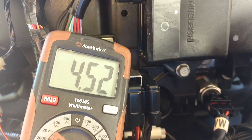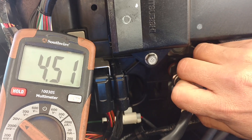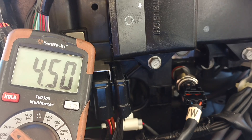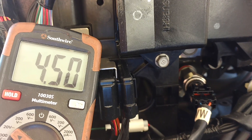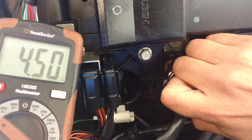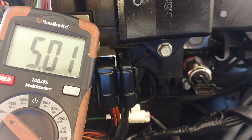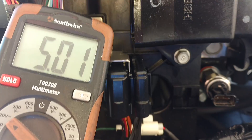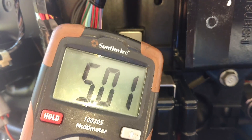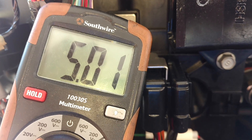So let's see what happens when we disconnect. I am going to pull loose our engine harness pigtail here at the water pressure sensor and see if our voltage comes back up. This is a test that is done with key on power — key on, engine off. Make sure everything is powered up. As you can see, all I did was disconnect the water pressure sensor pigtail on the engine harness from the water pressure sensor, and source voltage jumped right back up within the normal range, which is 5.0 or something extremely close to 5.00 volts.